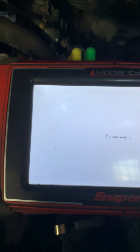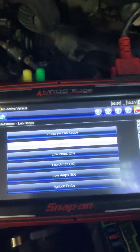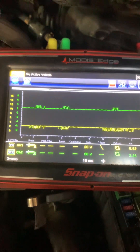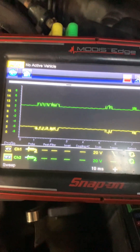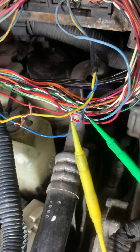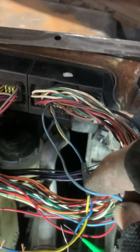Now I'm going to show you what I see and how I figure the problem. I go back to my scope — the scope is right here. We are looking at the CAN network. It's a good signal, plus and minus. We're looking at a good plus-minus from the K network, which is the yellow-blue wire. This is the blue wire — the K line wire — also working fine. But this is what I want to show you.